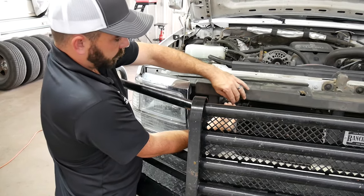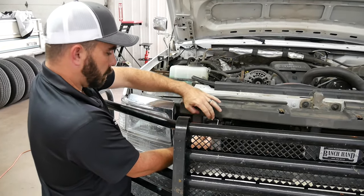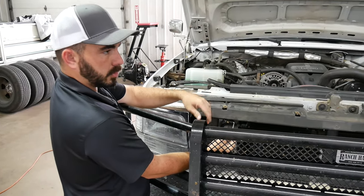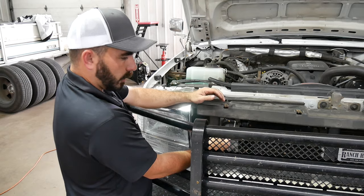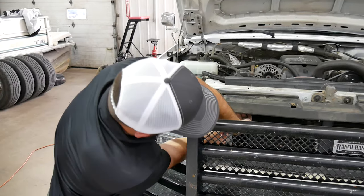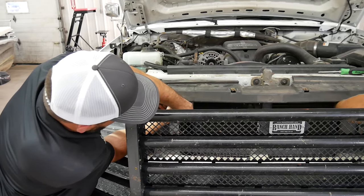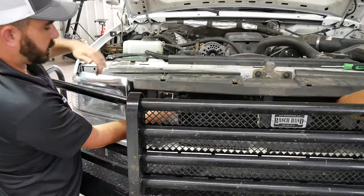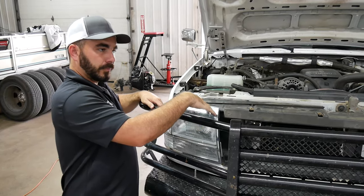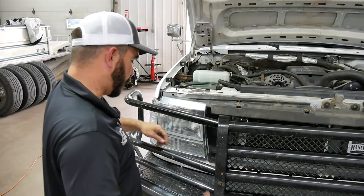This can be a little difficult because of lining the bolts up with the holes. Another option for a cleaner look is to turn the bolts straight up and put the nuts and lock washers on the other side. It's a little more difficult on this truck with the ranch hand. We're just going to loosely fit the brackets up, get the light bar in, snug the light bar, tighten the brackets, and then hopefully Vanna White will be back with our grill shortly.